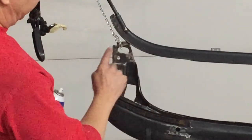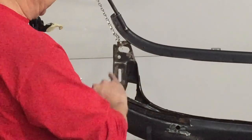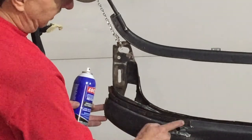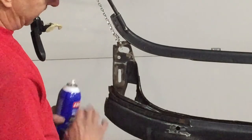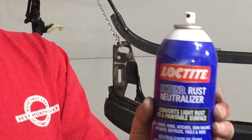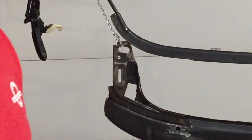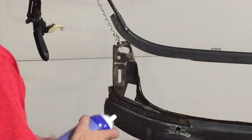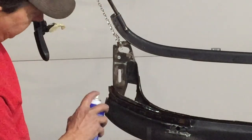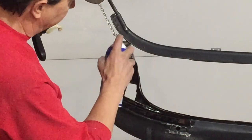In this area of the convertible top's front bow, there's some surface rust all over. These actually ended up being really good tack strips, so I didn't want to tear those out and have to rust-proof all over inside and clean it all out. I really like using a spray-on rust neutralizer — it turns the rust to a black primer. It works really good and you can get it pretty wet, and it really soaks into the rust.